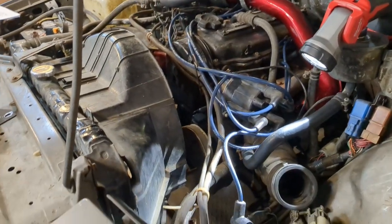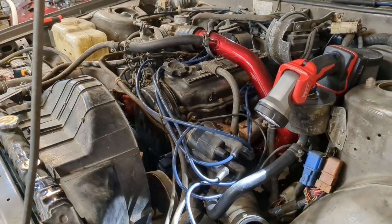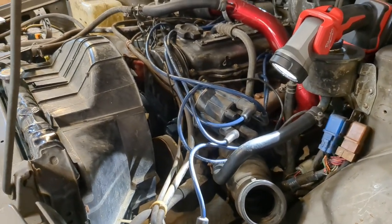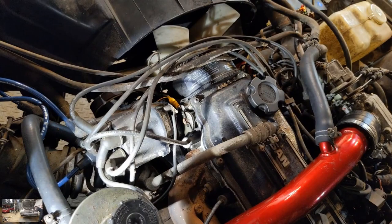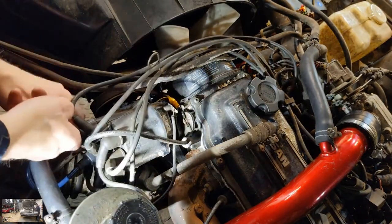Oh, no, no, no. Somebody tried to get this car working, and they were trial by firing it or something. So this is the car as it sits now. Currently, there's only four spark plug wires and one coil wire hooked up, as we are currently using just the intake coil. However, with all eight spark plug wires on there and two coils wires, it gets a little confusing. Confusing enough, in fact, that when I looked to replace the spark plug wires, because, again, they were cheap, literally $7 for a really nice set of spark plug wires, I was very baffled to find that the coil intake port, if you would call it, the connector, was hooked up to the exhaust spark plug number one, and every spark plug wire was just in disarray and everywhere. So even if we did have a working coil, it was never going to run.